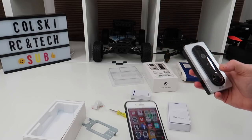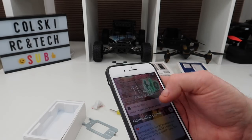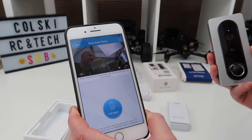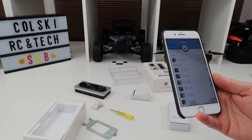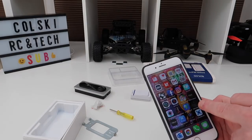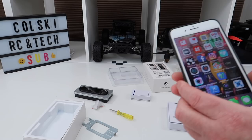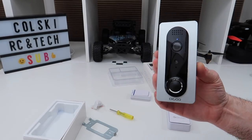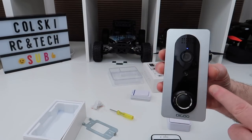So when someone presses the doorbell, you can see a notification on top — it says 'master,' though I think you can change that in settings. If I click on it, it tells me a visitor is ringing the bell and I can go check — as you can see, it's me at the door. This works wherever you are because it runs on 4G via an account. To set it up, download the Video Doorbell app, put your email in, create a password, and you're done — it automatically connects. Note: this works on 2.4GHz Wi-Fi only, not 5.8GHz. I've tested it on Sky and BT routers and both work fine.